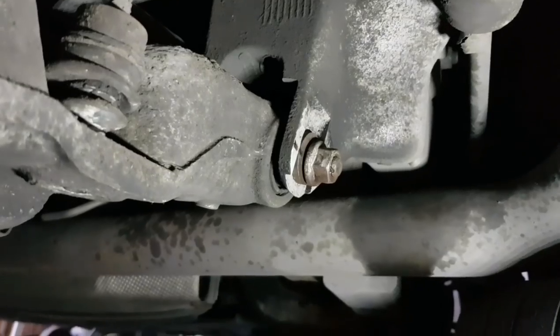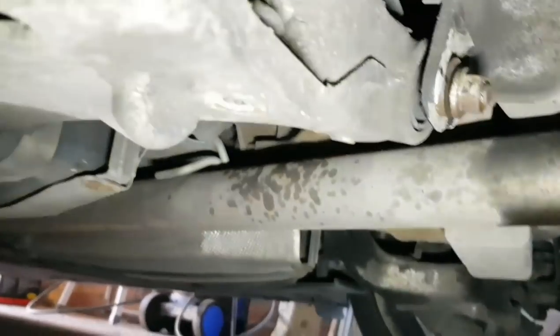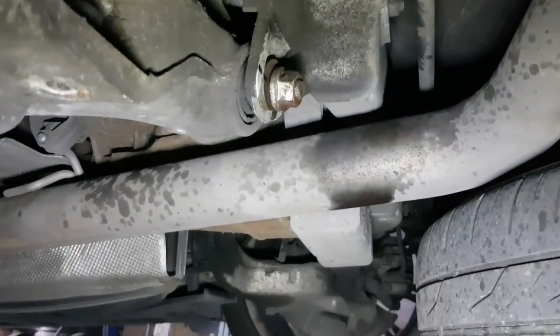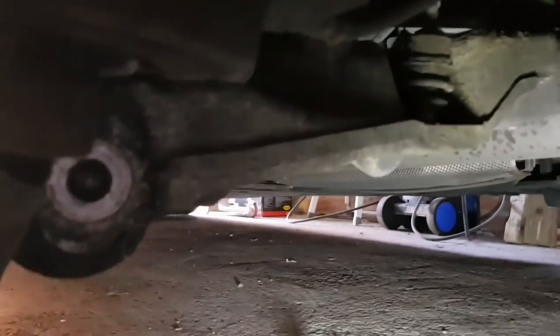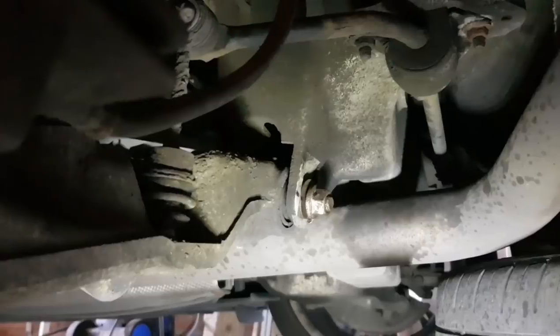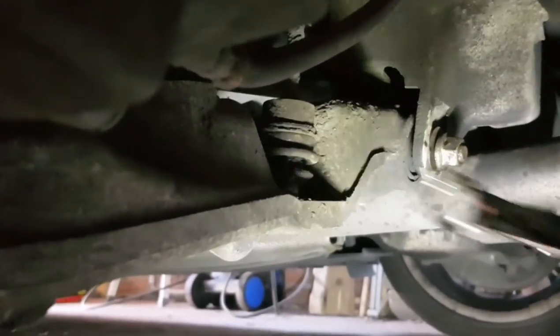So this back nut here is a 21 millimeter nut, and I have started to loosen that with my spanner. That was extremely tight. So I'm gonna take that out and see if this control arm gets any easier to push down out of the way, and if not, I'm gonna go to the last place where it's connected. The bushes are obviously tightened at ride height and it's trying to return there all the time. So I'm gonna loosen these down. I've already got the drop link detached.